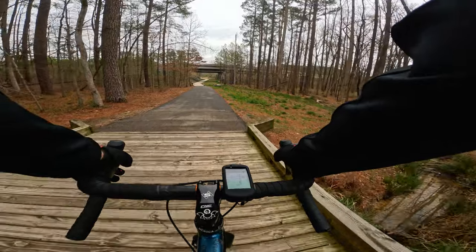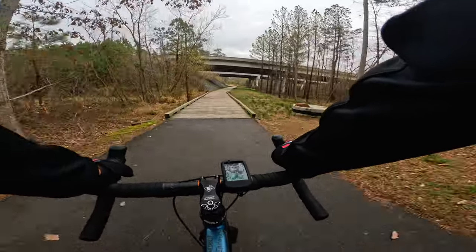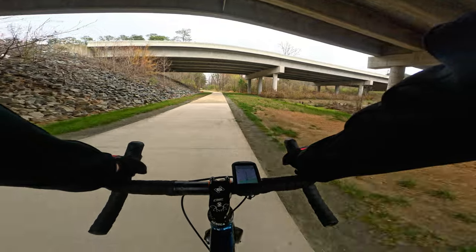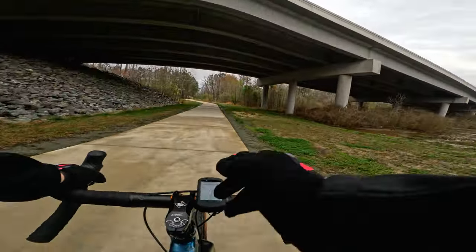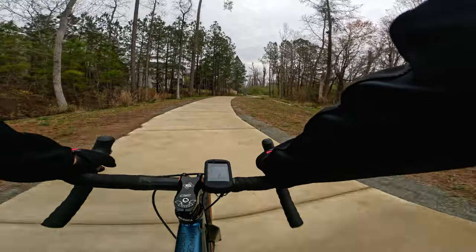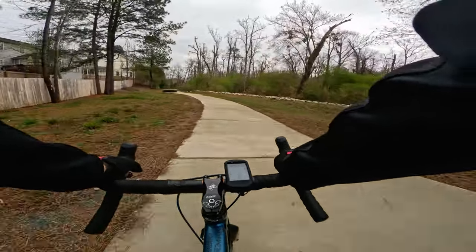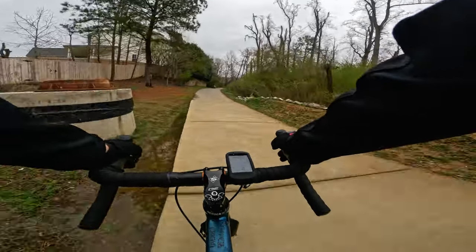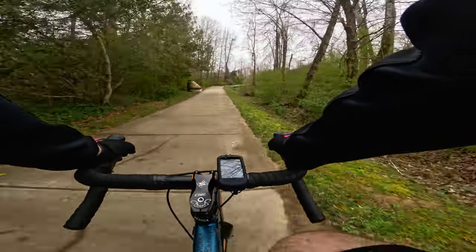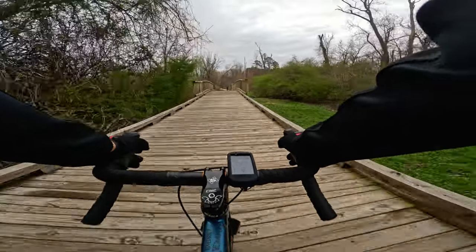So it appears that little floppy crash totally made me realize what I forgot to do on the bike. I forgot to put carbon paste on the actual stem piece right here, which when I was going down that descent made my bars turn — that's what the crash was about. Word of advice: don't forget to carbon paste your carbon bits. Also, what that seemed to have done was loosen up my headset a bit, which means I have to go home and adjust that. But for its first little epic adventure, it was pretty sweet. The headset's mad loose right now.